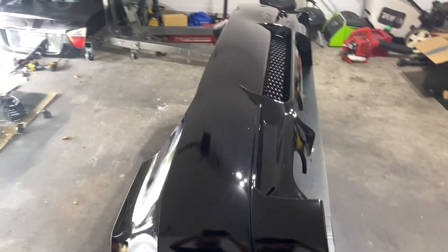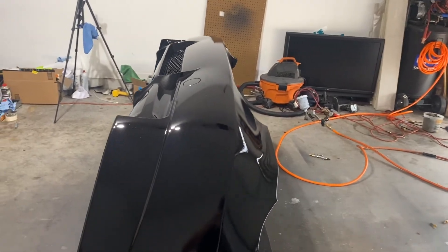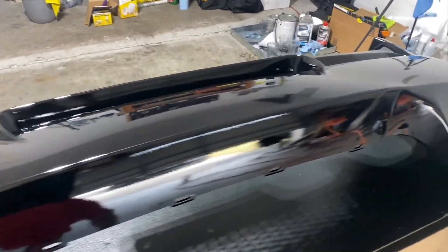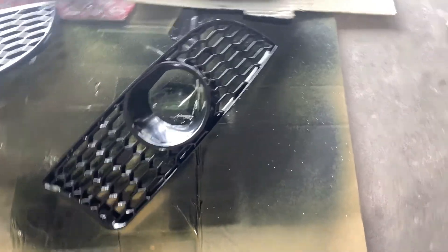This bumper has been flashing off for about 30 minutes. Here's what it looks like — doesn't look so bad. This is all before clear. I have decent coverage and I don't see any spots where you can see any lack of coverage or the greens from the black paint, so I think I might be good to go. I also went and sprayed these smaller pieces because I wanted them to be a little glossy as well. Now let me go ahead and mix some clear coat and get to spraying.